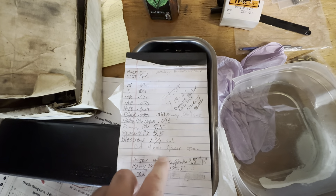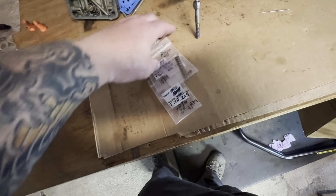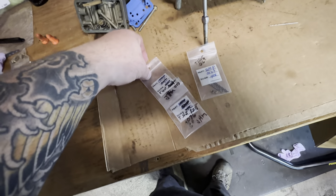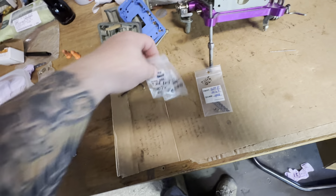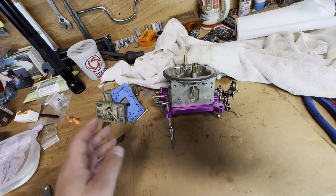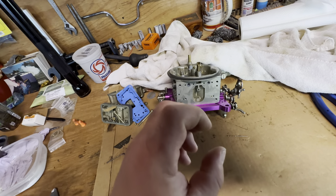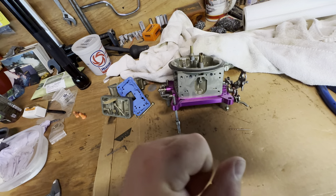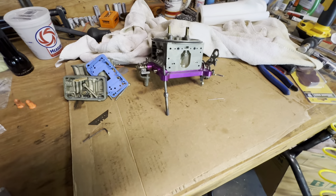If you look at this paperwork, every time I dropped it — it was 72, before that I think I had 75. I want about 3 or 4 thousandths every step. Here they are, actually — I saved them. That's 69, and I have some extras: 72 and 76. So I dropped like 4 thousandths, 3 thousandths a couple times. That's roughly 10 to 12% as you step down. Because as you get smaller in a circle, the area drops quicker and quicker. As you go up, it gets larger faster. So that's math and science.